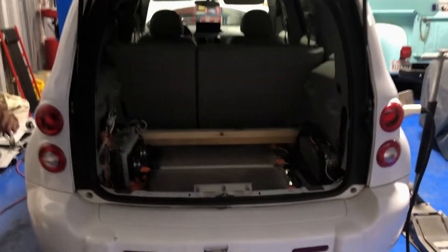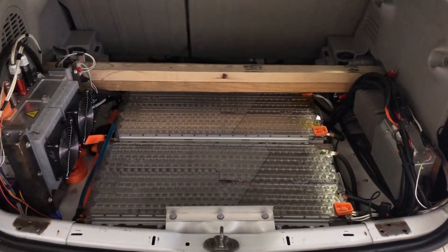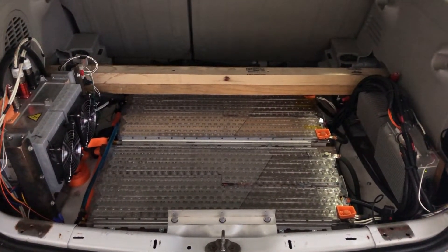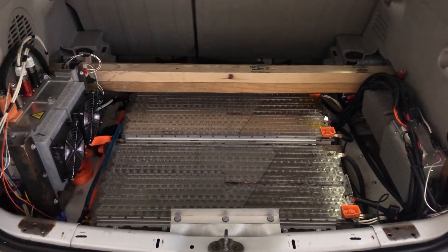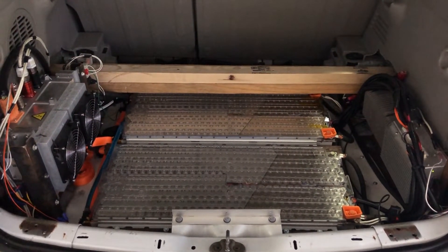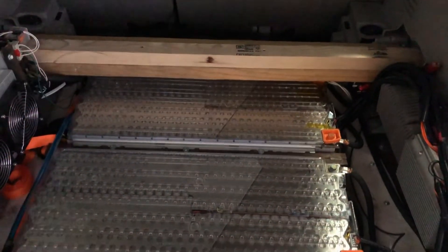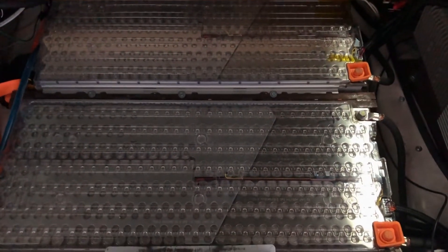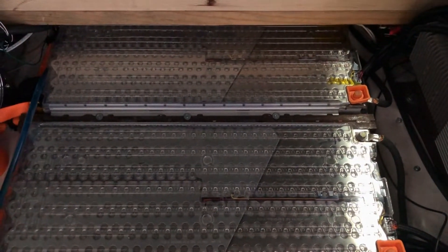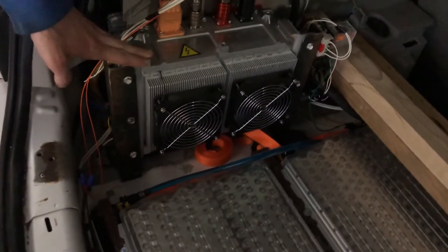Here is the most important part of any electric vehicle: the batteries. These are not the same batteries that were in the blazer — these are Tesla batteries out of a Model S. This is half of a base model Model S, so a little bit over 30 kilowatt-hours. Each Tesla module — this rectangular shape — there are six of them, each wired in series for a fully charged voltage of 151.2 volts, given that each individual cell has a fully charged voltage of 4.2 volts.